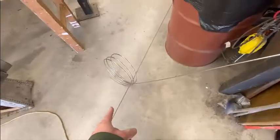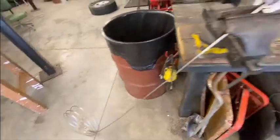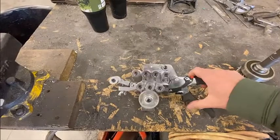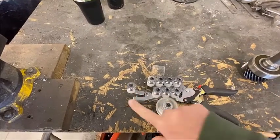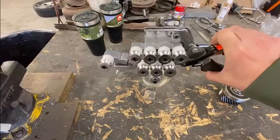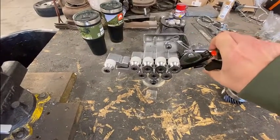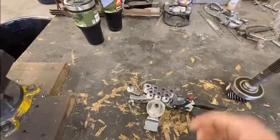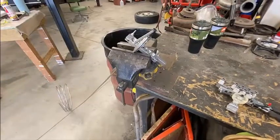As you notice, this is all coiled - that's how it comes. I got a straightener, I think from eBay, for like 50 or 80 bucks. It works really well. You're able to adjust it and run the line back and forth - this piece goes in the vise, clamp it down, it locks in place, and you just roll it back and forth through those rollers and that straightens it out. Let's see how we do on the flares.